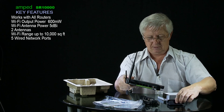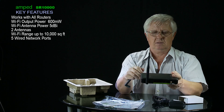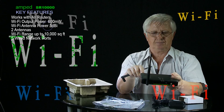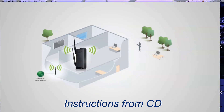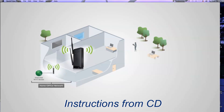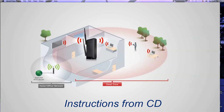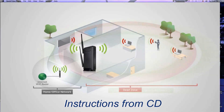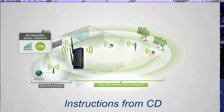Let's go to the next step and connect it to the router. The range extender should be placed in a location where it can obtain a strong signal from your home router — typically somewhere up to halfway between your router and your dead spot. If the range extender is placed where it can only receive a poor signal, that poor signal will be extended, making the extended network slow and unstable. Find a location where you receive 4 to 5 bars on a wireless laptop.